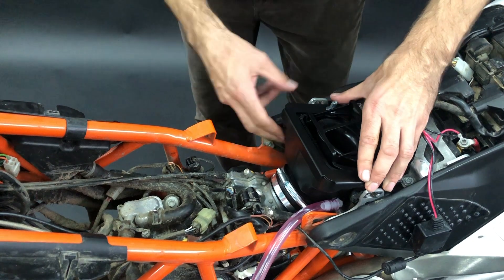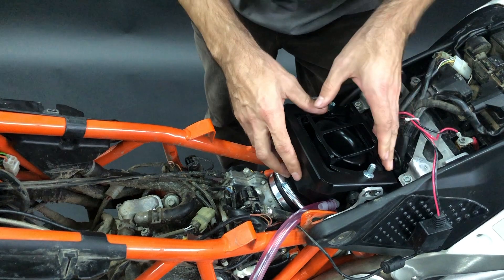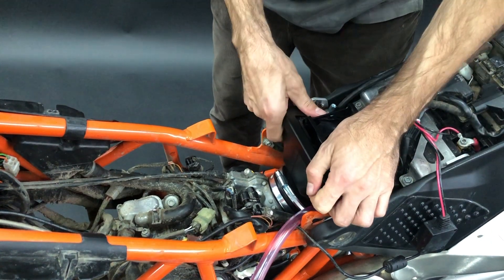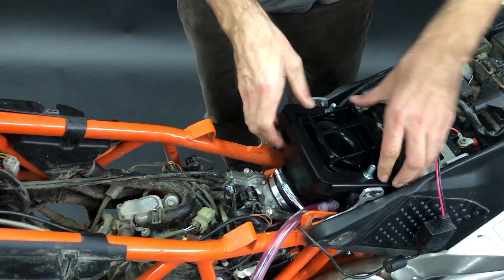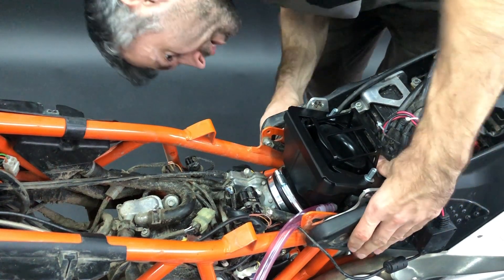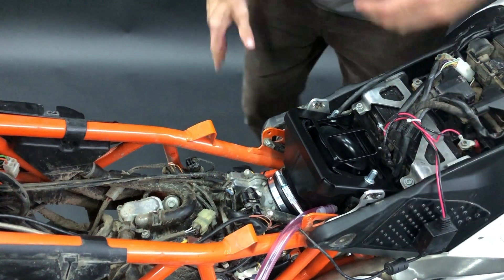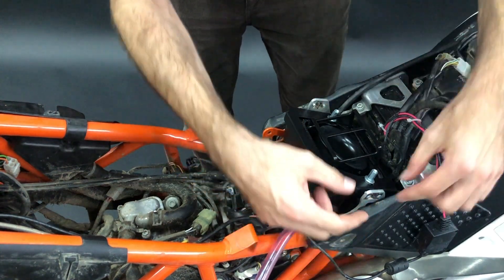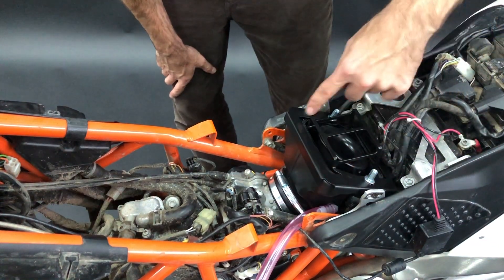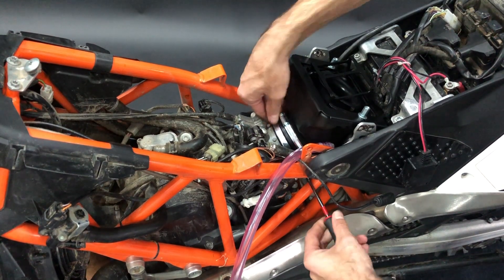Here is the harness on this side, so make sure you have space there. Get in between the pins and you can also press the fuel line down a little bit. Make sure you are well centered and then you click it on. You can do a check: the places for the pins must be above the frame for the air filter. Now tighten the sleeve holding the airbox to the intake.